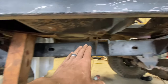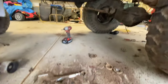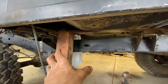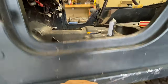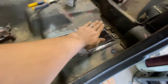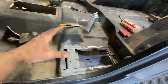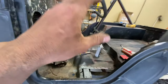All the body bushings are out, at least on this side. We have a few more to do on the other side, but that was nasty — so bad. Look at all the rust and dirt. I guess I shouldn't be surprised. Check this out — I think that's supposed to be a bolt, and it's just... not a bolt. Pretty wild. The next task is to clean up and finish our patch, get the other mount welded to the bottom really nice. We're going to make sure to bolt everything in before we tack the actual mount so we know it's all aligned, then do the other side.